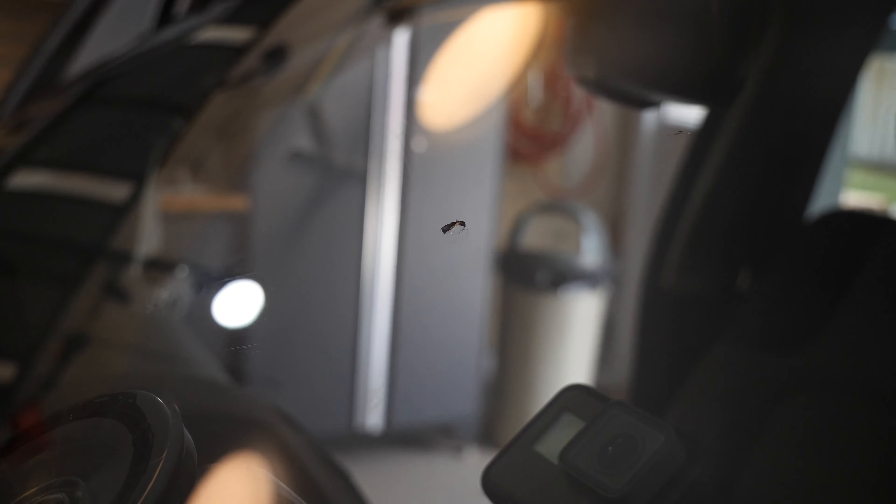Here's our bullseye after, and as you can see it's still pretty visible. The reason being is that's really because of the dirt that I let get in there — this bullseye is actually a pretty old crack. So I'm not going to hold that against the Permatex repair kit. The actual bullseye itself is really well filled and it's filled with very, very clear material. So as far as the actual repair, it went pretty well. It's just I let a little bit too much dirt get in there.